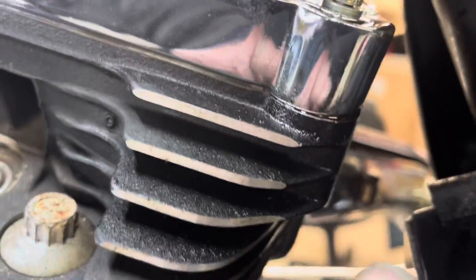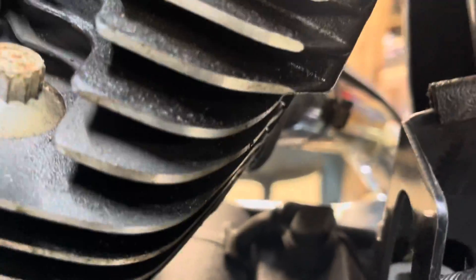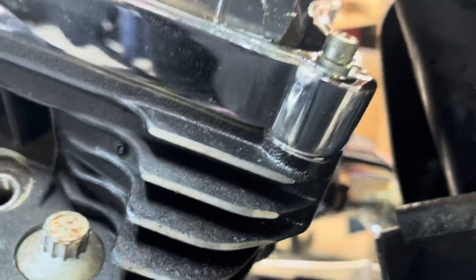The bars themselves are okay, but the levers and the switch housings are rolled back in an awkward position. And the big problem was right here — we had a leak on the rear rocker cover box. As you can see, I've got it partially disassembled, but you can see here where the oil was leaking down. You can see the puddles down here, and everything in this area is wet and yucky because this bottom rocker box gasket has failed.